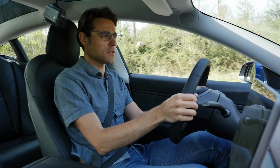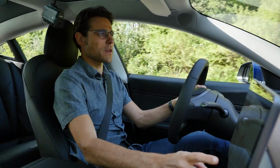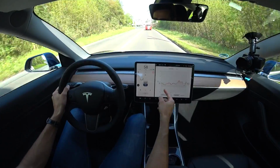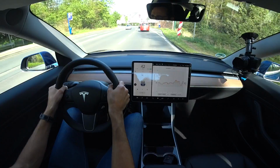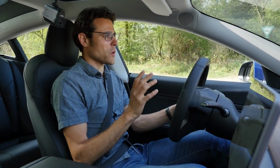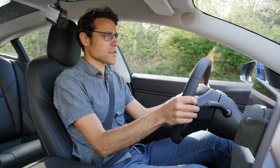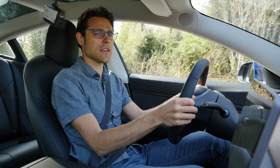And that shows you, I can even get lower. Now it's already at 14, 13 for 25 kilometers, about 17 here now. That was a little bit higher speed in there, but over the last 50 kilometers it says again 14.6 kilowatt hours per 100 kilometers. So again, 14 kilowatt hours per 100 kilometers or 25 kilowatt hours per 100 miles is a realistic figure, and that shows you that the official range figure of 300 miles plus and 550 kilometers plus is actually realistic for this long range model.